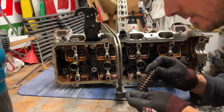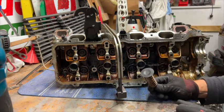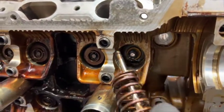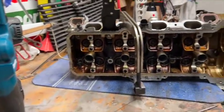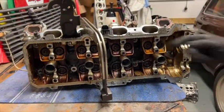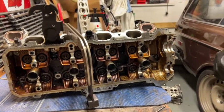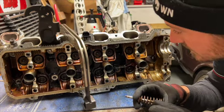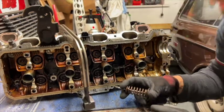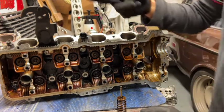So I'm now going to get a cardboard, label it up, and just start unstringing all of these. Right, that's the valve seal - now that's the little bugger. That's the main reason I pulled these heads, just to do these valve seals. And while I was there, I thought I'd just do all the valves and stuff. They're just a bit hard - all the seals on this are a little bit hard and a bit dry. So I just thought, why not?